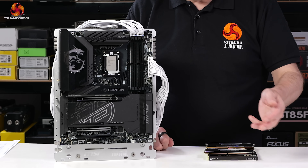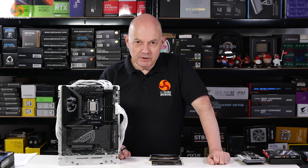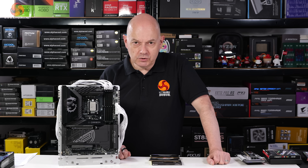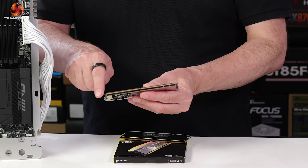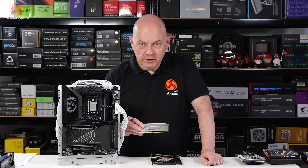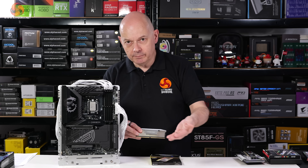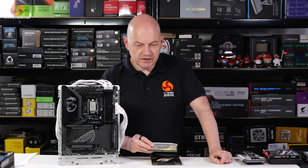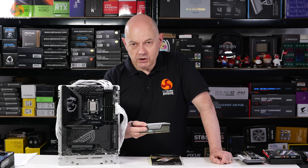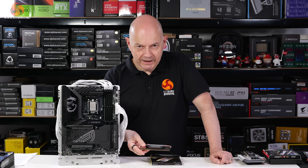As to why you require it for Arrow Lake, it comes down to suspicion. Essentially Intel needed all the help they could get — they asked the memory manufacturers to supply really fast memory, and this was the solution. It's a tweak to conventional DDR5 memory, an extra chip that allows them to jack up speeds by 1,000 or 2,000 megatransfers for not a huge amount of extra cost. The really significant part is that this is exactly the same key as regular DDR5 — regular DDR5 memory and DDR5 CU-DIMMs both plug into the same slots. In other words, you can plug regular DDR5 6000 or 6800 into a Z890 board, and you can plug Corsair Vengeance RGB CU-DIMM memory into your AMD motherboard — though you can be fairly confident the AMD memory controller won't know what to make of it and doesn't require it.